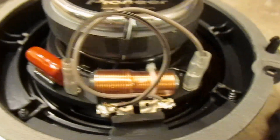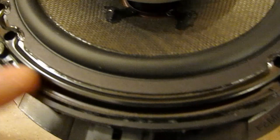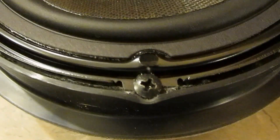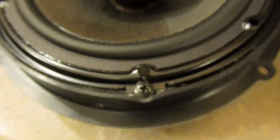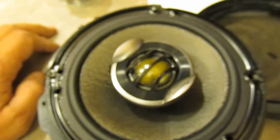Left soldered to left, right soldered to right. On the front side, each speaker is going to have a different amount of clearance between the plastic ring and the metal speaker. On this one it's a lot tighter than the Infinities I put in my other cars, but it's screwed in fine. Now it's hot glue gun time — we're going to fill in all the gaps between the plastic and the metal. It helps with vibration and also just in case one of the screw threads lets go, it will still hold.